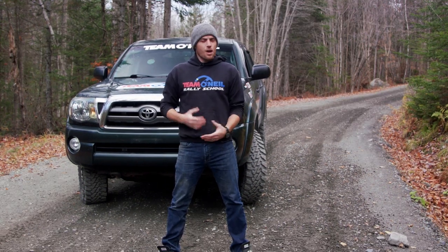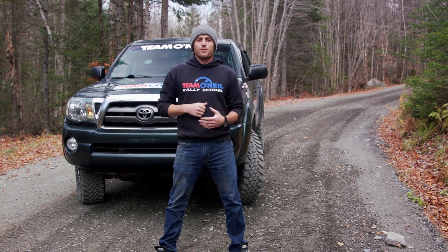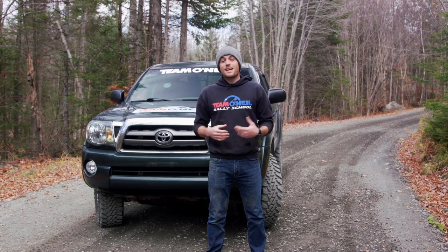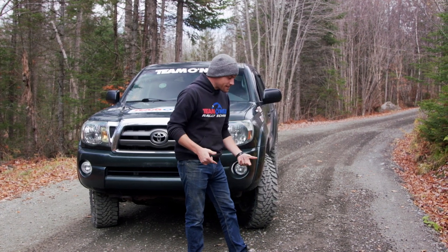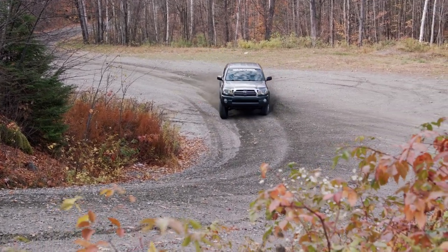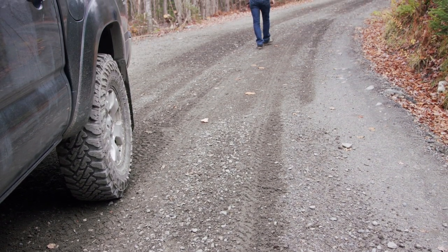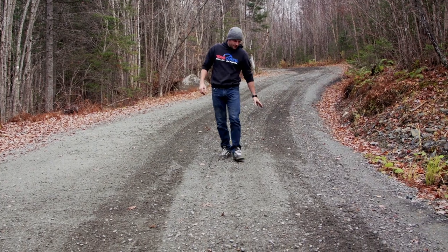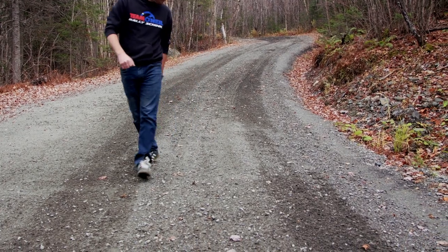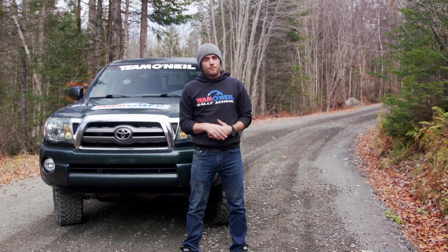So at the end of the day, we managed to hustle this little Tacoma around our course in just a fraction of a second under two minutes. Switching the tires made a huge difference, but it didn't completely alleviate all of our bounciness issues. We're definitely going to take a look at some heavier duty suspension for this truck moving forward. One easy way to tell is to go hot and then look at the tracks you left — in this case, you'll see there are entire stretches of road where the tires are leaving the ground, and it's not over a jump or a crest. There's no reason your tires should be leaving the ground in those situations. The more your tires are on the ground, the more grip you're going to have. The other side of that is the more the vehicle's bouncing and rebounding in corners, you as a driver have to manage that with left foot braking and slowing your speed down — otherwise you're just going to bounce and eject yourself off into the trees.